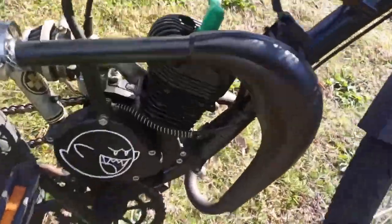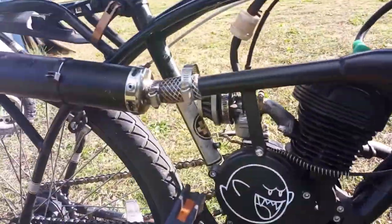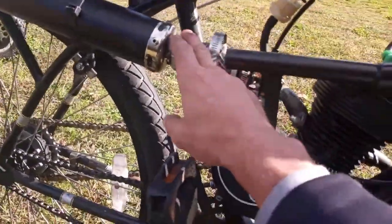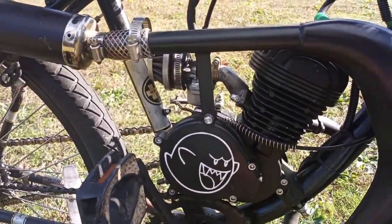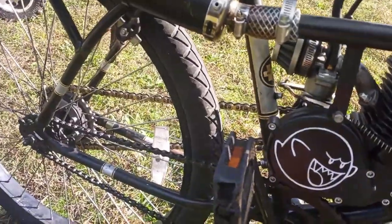When it comes to aftermarket heads improving cooling, it's not really the size that matters, it's the surface area. You can see the side slits on this particular head, which are what helps give it a little bit more surface area. Otherwise, it would just be a larger chunk of metal to heat up and cool down and wouldn't make much of a difference.